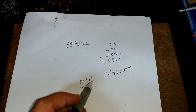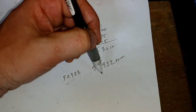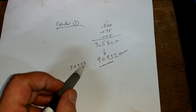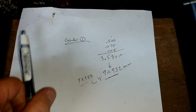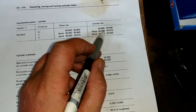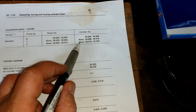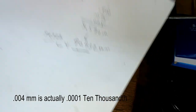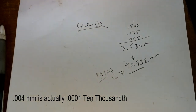That's four thousandths over in the decimal place — though it's millimeters, not inches. I'm four over in that thousandths position. So my cylinder one is out of factory spec by four thousandths. I think I can deal with that — I'm not going to replace those sleeves. But that's just one sleeve, so let's go check the next one.